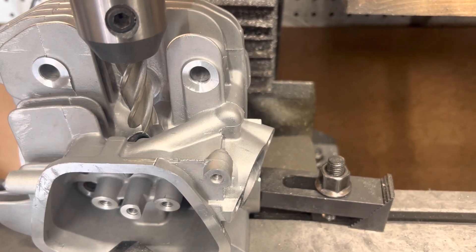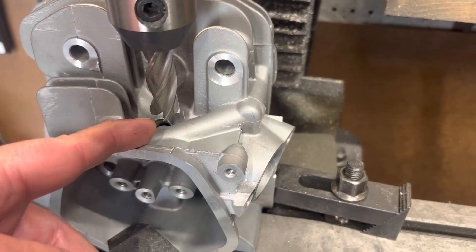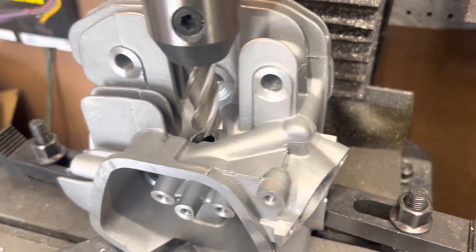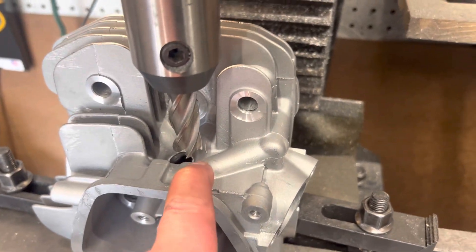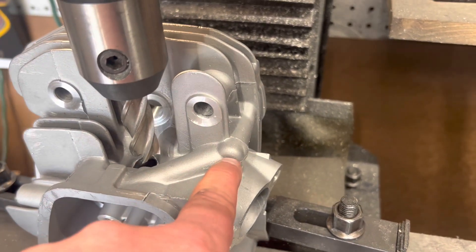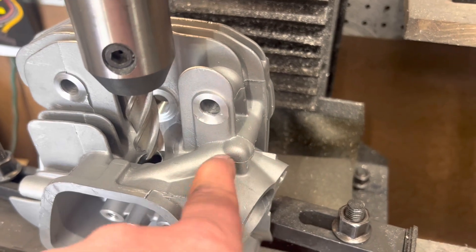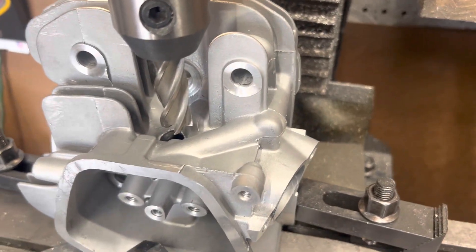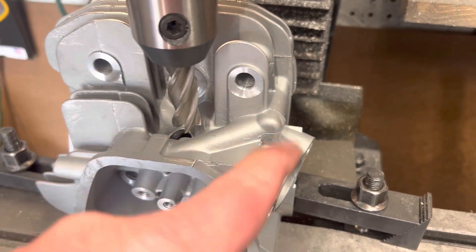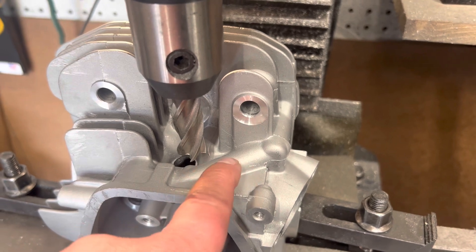On the small blocks it's pretty simple — basically it's just a one-shot deal, you can put a rod in. But these have a bend in them, so on these what we do is we take this, set it up on the mill, mill this open, and open up this side. We take off this side here and the top here to allow for a nice clean cut, and then we can come in and weld this from the inside out.